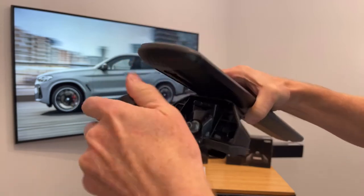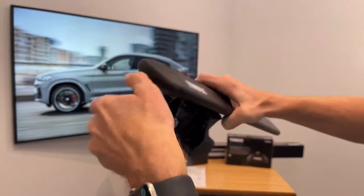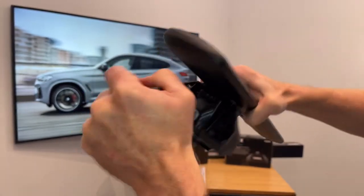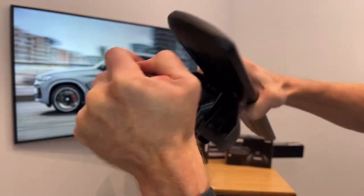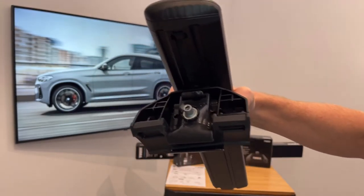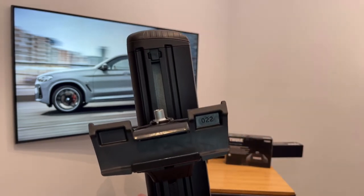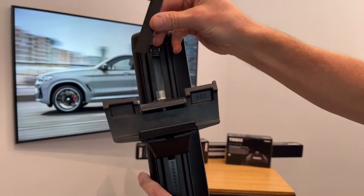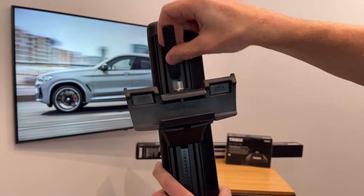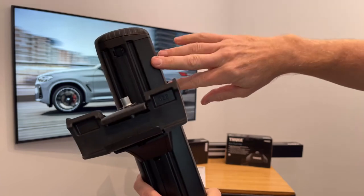This tool will click once it's reached full tightness, and then you know you've reached the maximum tightness to the side rail. On the underside of the bar you'll notice there is some exposed slot, and we do want to fill that in with rubber that's included with the load bars in order to maintain good airflow underneath the bar.